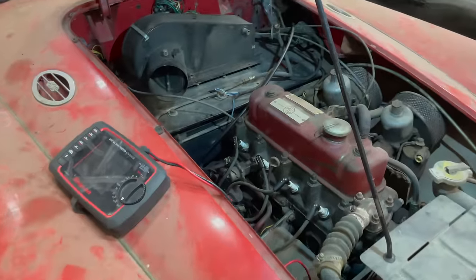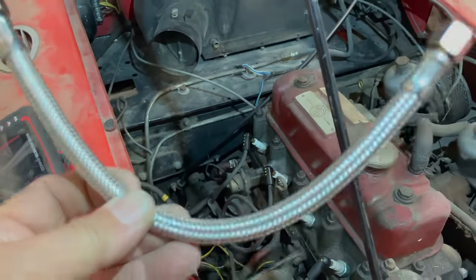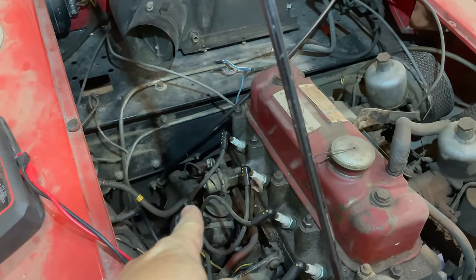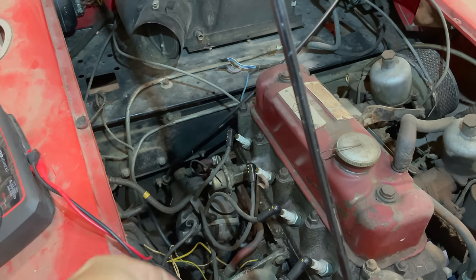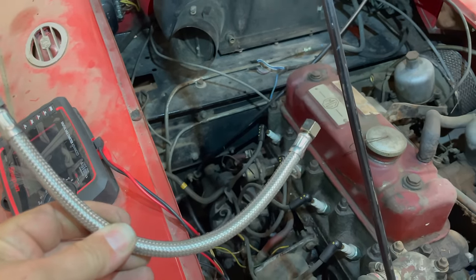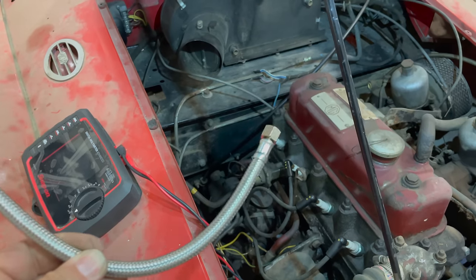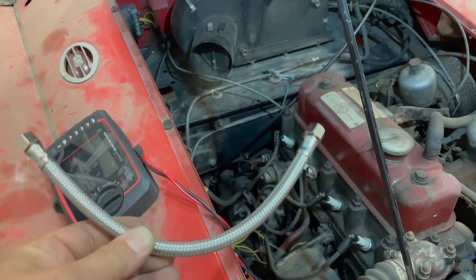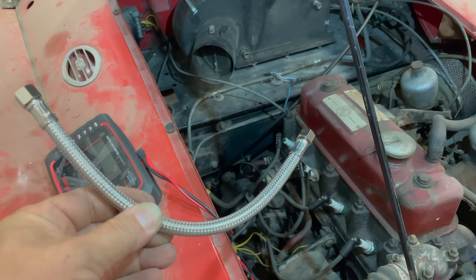And right now, I think I will start with the obvious problem, which is replacing this oil line. So this one right here has that little piece of yellow rubber around it. I'll replace that with a new one, because that was leaking last time, and that was what made me stop that video. I will need a 1/4-inch Whitworth wrench for each side of this to get it replaced. Shouldn't take very long.